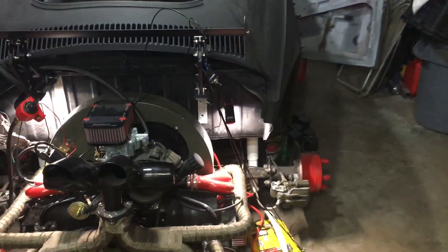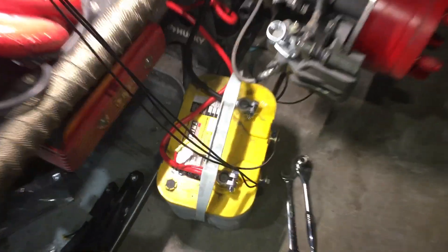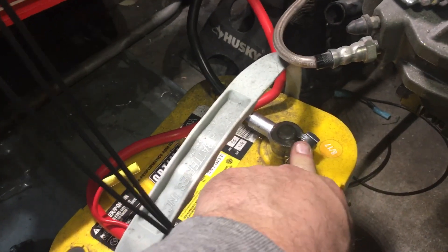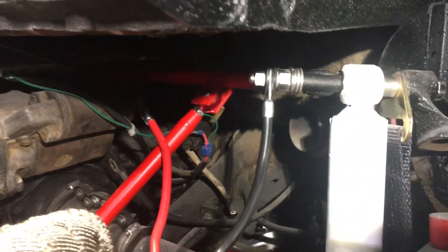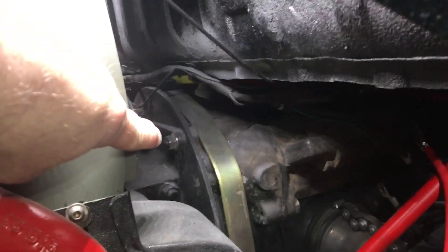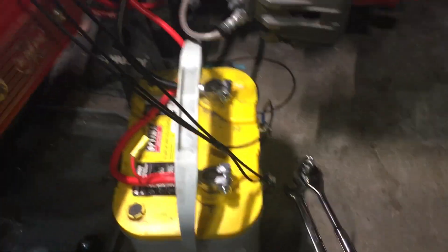For this you're gonna need a battery, a positive lead coming off the battery going to the starter coil. From there you're gonna come back to the battery and connect a negative lead to some sort of grounding bolt — in this case I used the shock tower. On a bench mount you'd want to mount it to the transmission, since you need the transmission mounted to the engine to turn the flywheel and actually start the engine.